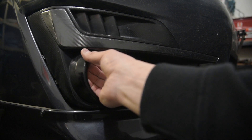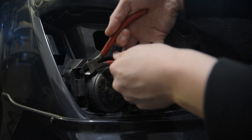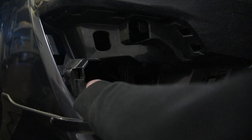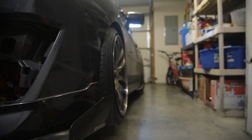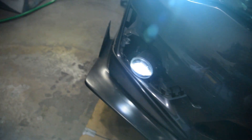Alright, so we're going to take off the bezel quick, disconnect the fog light, take off all the stuff underneath, remove the bolts, take off the zip tie. Here it is — I'm going to disconnect it here. Took that off. Now let's see if this will work on the other side. Here's the working fog light — I'm going to see if I can use this plug. I got it plugged in, let's see if it turns on. If it turns on, that means my wiring is fine. And it looks like my wiring is fine.